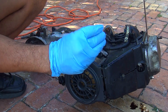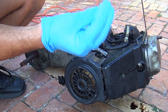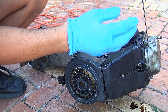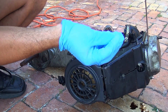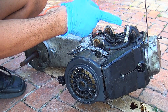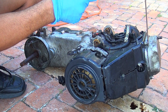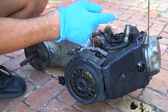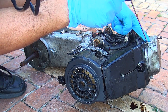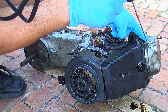The starter clutch is going to make a funny noise when you point here. If you have a noise on your scooter coming from the front part of the motor, with the stethoscope you can point on the front part of the cover and you are going to hear the valve opening and closing — clap, clap, clap. If that clapping noise is too loud or the volume is really high, you might have to open the front cover of the motor and check the valve clearance. To hear this, point the stethoscope on the front valve cover.